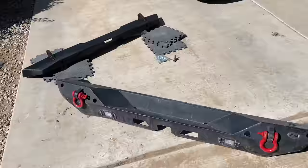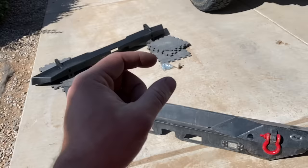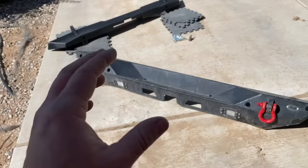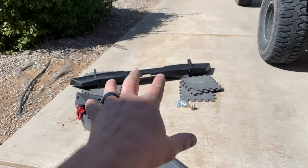After you consider the size, tighter to the Jeep is better — it gives you more clearance, you hit less rocks when you're out doing off-road stuff, and your bumper will look better longer. Another thing to pay attention to is weight. The Cav Fab bumper weighs 39 pounds; the DV8 weighs about 75 pounds. That's a huge difference. You want something tight, well built, and that provides maximum departure angle clearance.